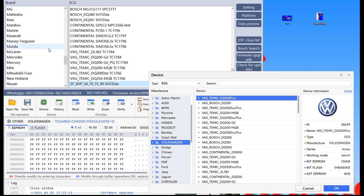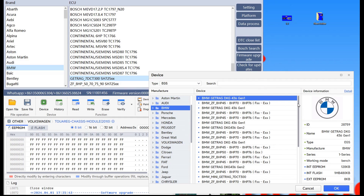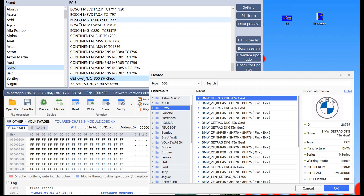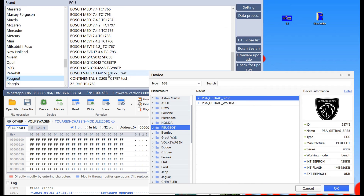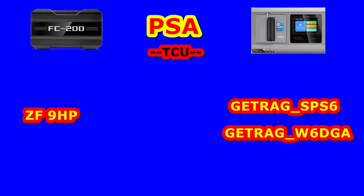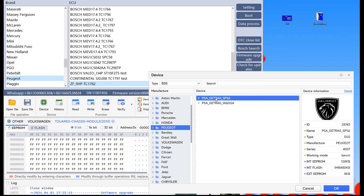Let's jump also to BMW. On BMW this is the one I found — and you see on the picture that VVDI has two more types of TCU while FC200 has one type. Let's also jump to PSA group. You notice FC200 has this type of TCU — I didn't know it's installed on Peugeot, maybe on V6. I've never had to deal with this type of TCU from Peugeot — if you know leave me a comment below. The 9HP — should be maybe in the newest generation from Peugeot. And over here VVDI has these two additional TCUs. And here I will finish my comparison of FC200 and VVDI Multiprog.